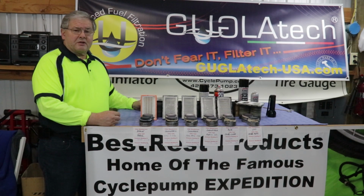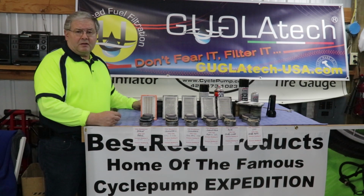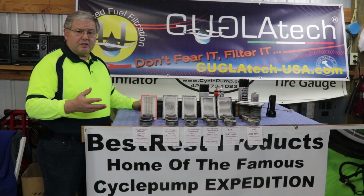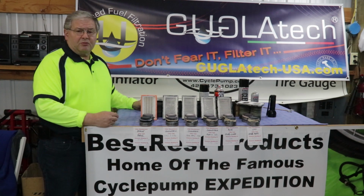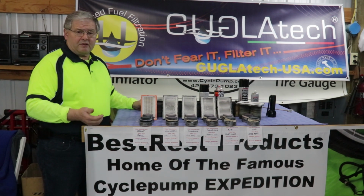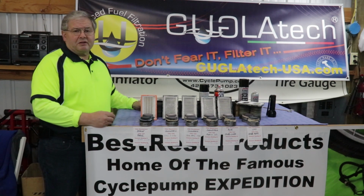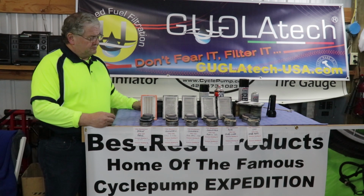So we've concluded our test, part 3 of motorcycle air filters in the nuclear age. In this test, we tripled the amount of contamination that we introduced into the filters, both for the BestRest and also the talc, 30 grams as opposed to 12 grams. So this is really subjecting the filters to the worst case scenario that you would encounter on the trail.